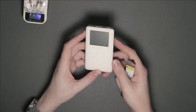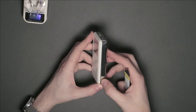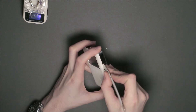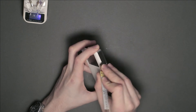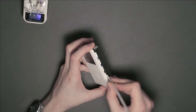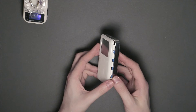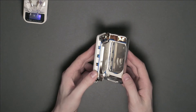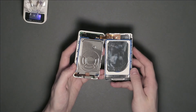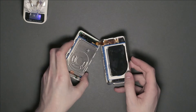To charge the battery, we need to get to the battery contacts that are inside the iPod. Getting into these iPods that have a plastic front is pretty easy. All you have to do is slide your spudger in between the plastic front piece and the metal back piece, and then release the plastic clips that are holding them together. When one side is loose, do the same on the other side, and then all of the internals should pop right out, like the contents of a flimsy burrito. Sadly, judging from the fingerprints, someone has already been inside my burrito.